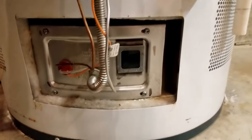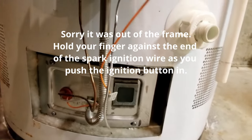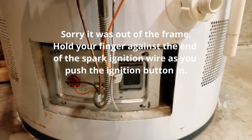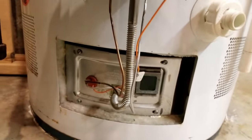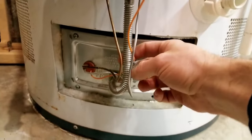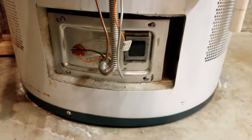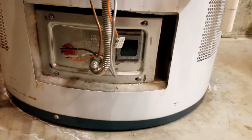While you have it apart, you can also hold your finger on the end of the ignition cord. When you push the igniter, you should feel a little tickle. It won't be a big shock — you'll be fine. If you do that and feel nothing, then you do have some sort of a problem with the igniter. But if you are feeling a shock at the end of the cord, it means it is getting some current down there, and probably the problem is with your burner itself — hopefully the cleaning will help.